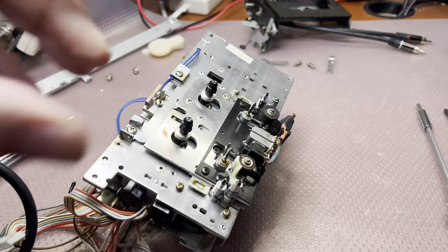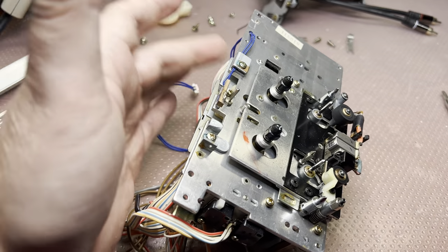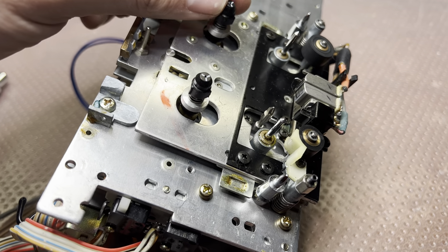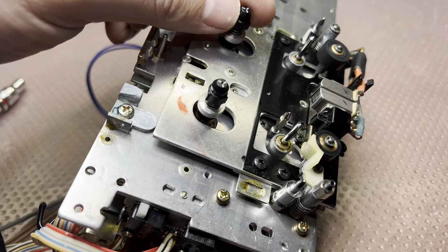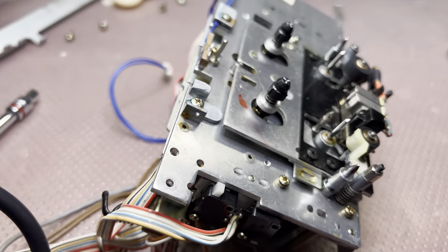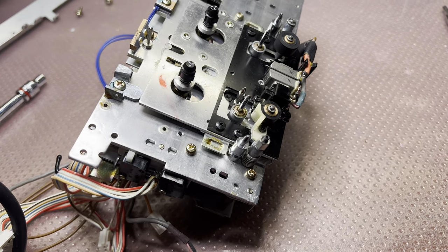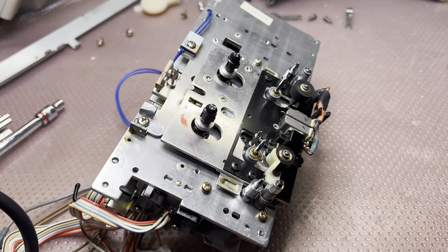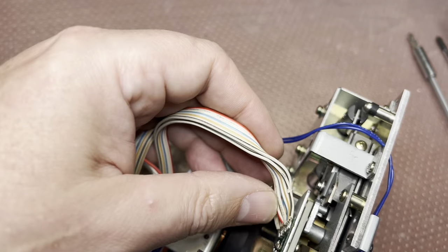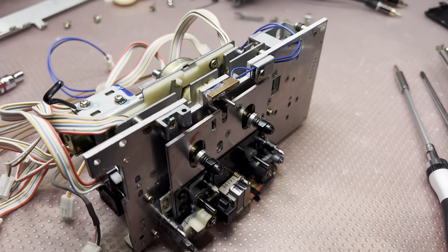I have no other choice - I fully disassemble this tape transport because I need to lubricate the shaft, it's screaming. I also found that these reels don't sit properly - they flex too much, and when they rotate the tape something is wrong. I need to check what's wrong - probably they are not properly assembled. I'm already using my arsenal of automotive tools to disassemble this. I can see the magnetic part and I would replace the idlers - I believe they are not holding well.